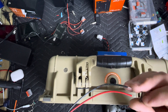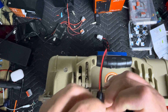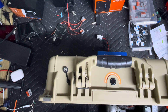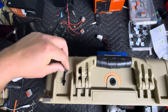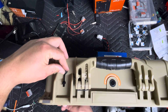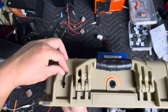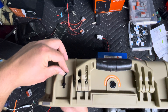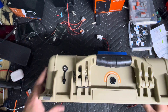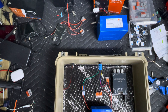Now we've got to assemble this. We're going to put the grommet on. Remember, anything — switches, grommets, anything that's going to be threaded and tightened into the box — if you want a little added security, just go ahead and throw a little silicone around it and you'll be good to go. Now we're going to install the locking ring. If you make it too tight and force it in, you can damage the threads unless you use the metal ones. With the metal ones, fair warning — sometimes they're reverse polarity. If that happens, you will fry stuff. Be aware of that.